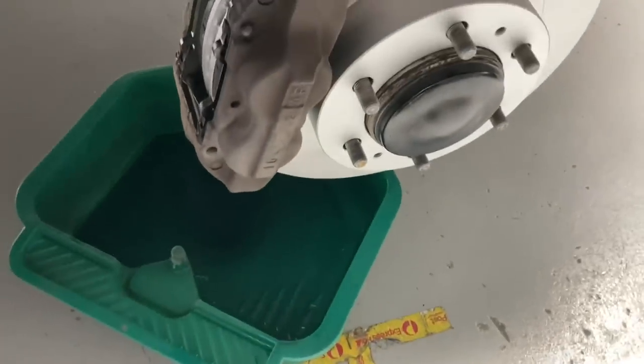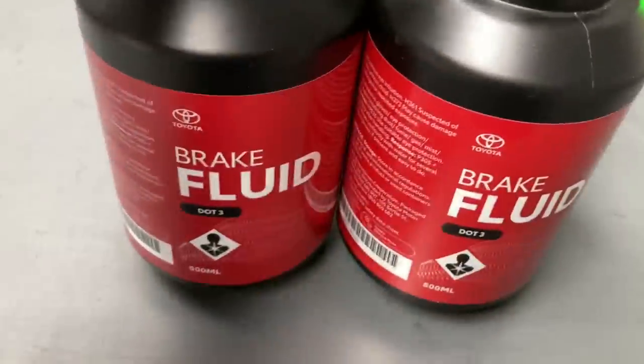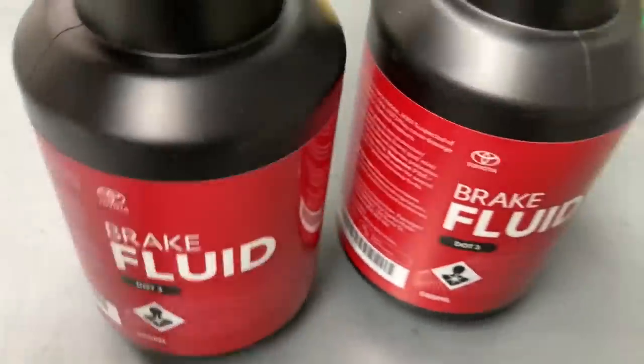You can get all these little one-way valves and put tubes on and do whatever you want, but at the end of the day when you connect and disconnect the tube it's going to leak and you're still going to need to wash and clean it up. So just let it go and drip there, and we've got to wash everything with water at the end anyway. Same at the other side. This one's actually got the rubber dust boot it's meant to have on. Just like the other side that will start dripping. All we've got to do now is monitor the brake fluid. We are using genuine Toyota brake fluid dot 3 from a sealed container.